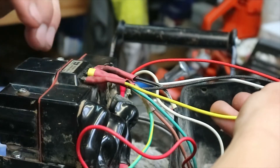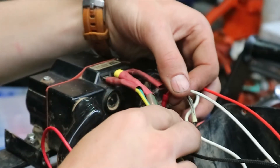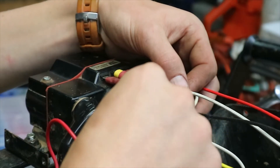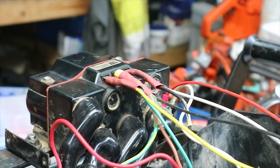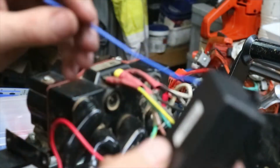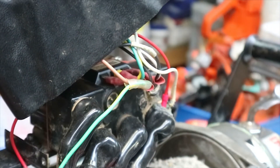I've put the black wire into the middle, the white wire from the controller with the black wire, and the yellow wire from the controller with the green wire. These colours may differ for your winch, but just doing the simple checks I described at the start, you can work out which wire controls your in and which wire controls your out, and then you match this up to suit. The red wire just goes down to the battery bolt down here, which makes it nice and easy.